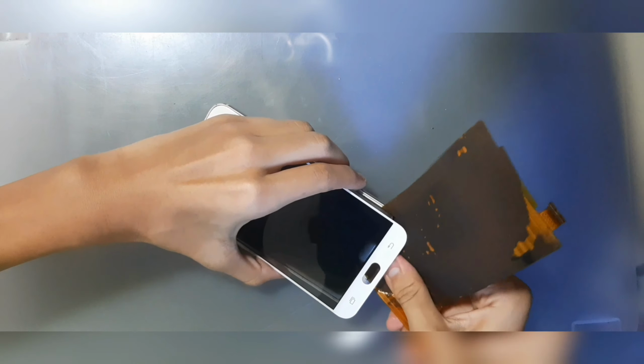If your phone starts up at this point or it's still on at this point, I'm gonna show you how to deal with it later. Right over here, I'm going to be ruthless. I'm gonna use this copper sheet found under the Galaxy Note 3 OLED display. Once we've got everything out of the way, thanks to my impatience, you can just take out the bracket covering the OLED and then unplug the screen.